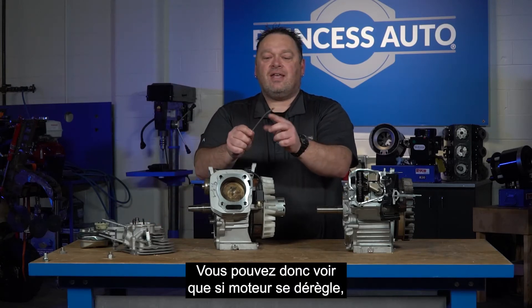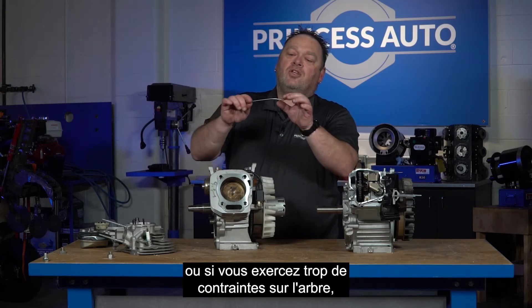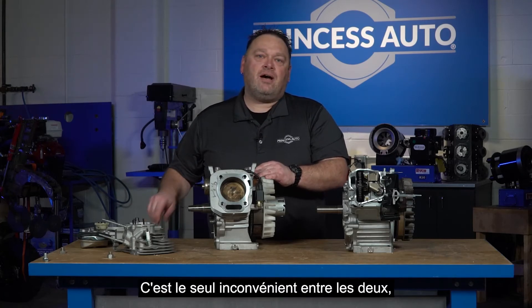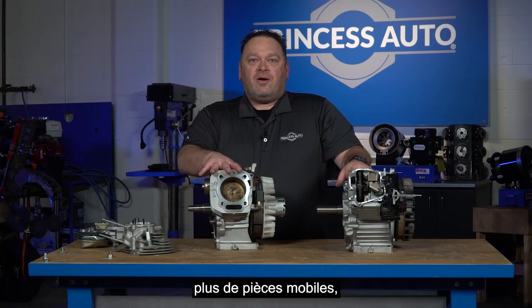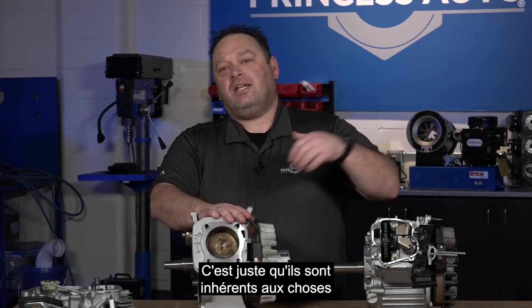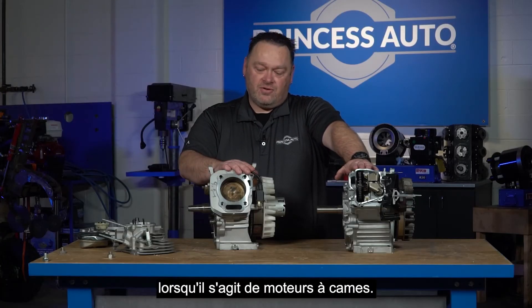You can see that if you get out of timing — something skips or you put too much stress on the shafting — you may drop out of timing and bend your rods because things aren't opening the way they should be. That is the one downfall: more moving parts, more things to go wrong. Push rod engines are the staple of small engines and standard in the industry, but they are inherently prone to issues with more moving parts. Cam-driven engines are much more efficient in that regard.